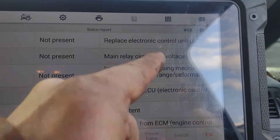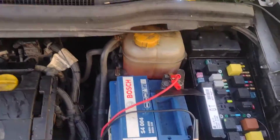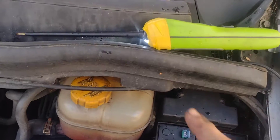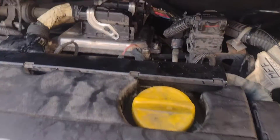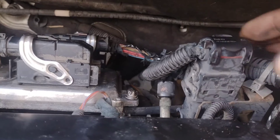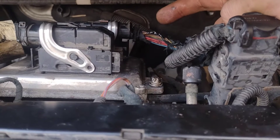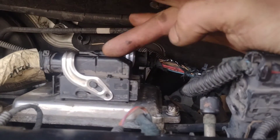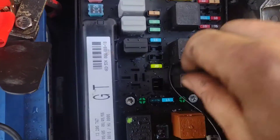I've gone for the relay, fixed the relay and fixed the communication. It was raining so I just got on with it. Using a power probe, I managed to figure out that the relay wasn't working — it was the ground side for the control side of it. That ground side goes to the engine ECU. The wire is brown and yellow — the only brown and yellow on the back plug out of these two. The ECU is the back plug, and it goes to the control side of this main relay.